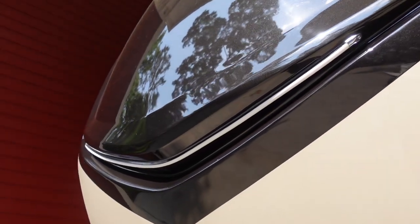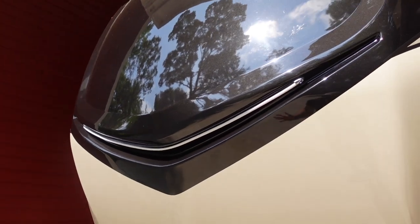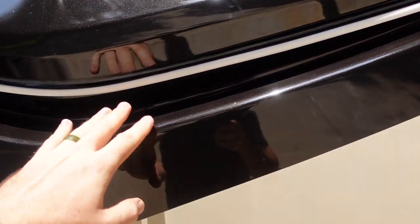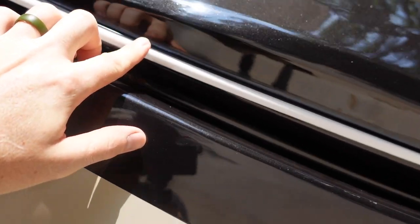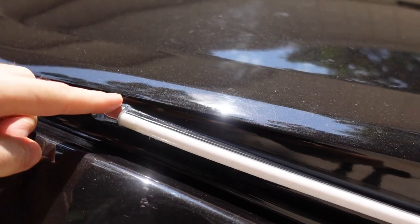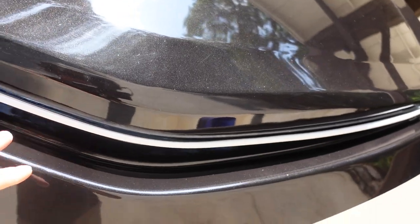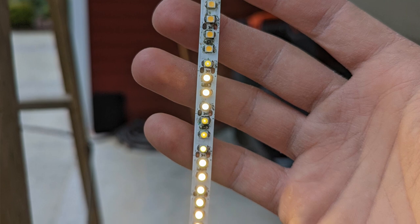When I got my Pinnacle back in the summer of 2021, I never really gave much thought to how the LED light was designed on the front cap — it was off my radar to check that it was all sealed up properly. Until about six months into ownership, the LED started going dim toward the center. That's when I realized it's basically just a vinyl tube with an LED strip slid inside, and the ends of the tube weren't sealed up. Water eventually got into the tube, settled toward the center, and submerged the LED strip. It probably short-circuited due to the water acting as a conductor.